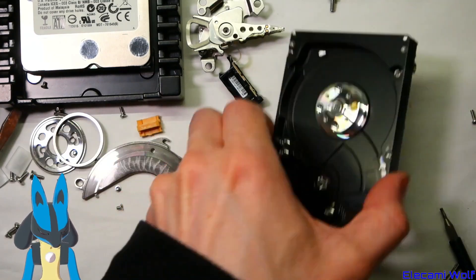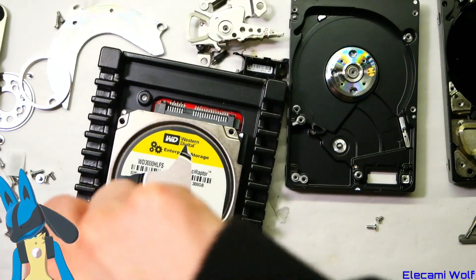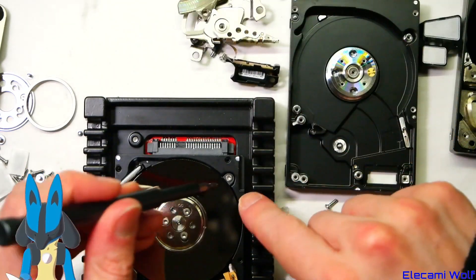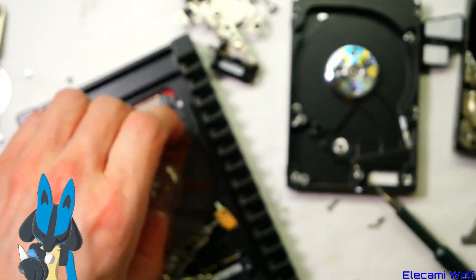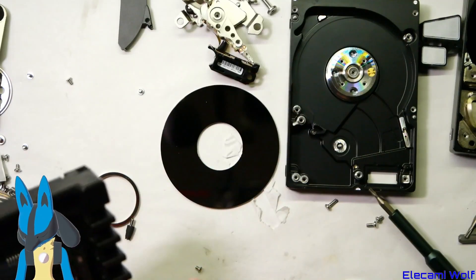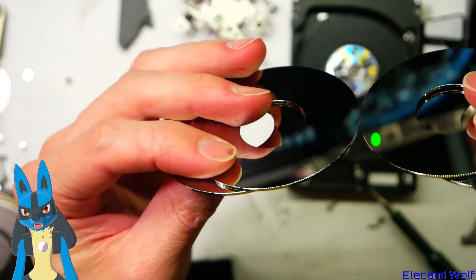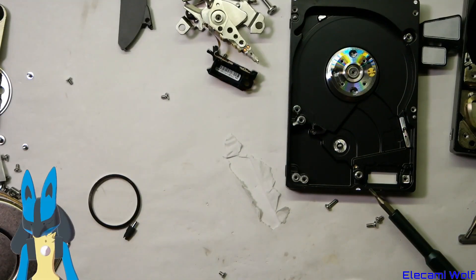That's the Velociraptors done. Let's look in the 300 gig one to see whether that is one or two platters. Damn — we've got the Cheetah drives next. It's two platters — okay, so it is just double the 150, it's not a higher density. And it looks like it's got that internal separator thing. Those are the screws there that hold them — it's a plastic separator. There you go — Velociraptor 300 gig platters. They're quite thick — maybe thicker than those ones.